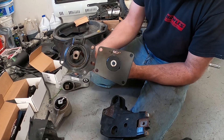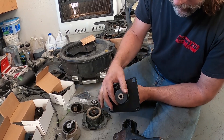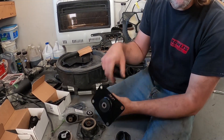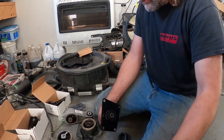That's what we're upgrading to. No play, no nothing. It comes with a bolt — make sure you use the correct bolt, or it'll go in too far and hit your timing belt.